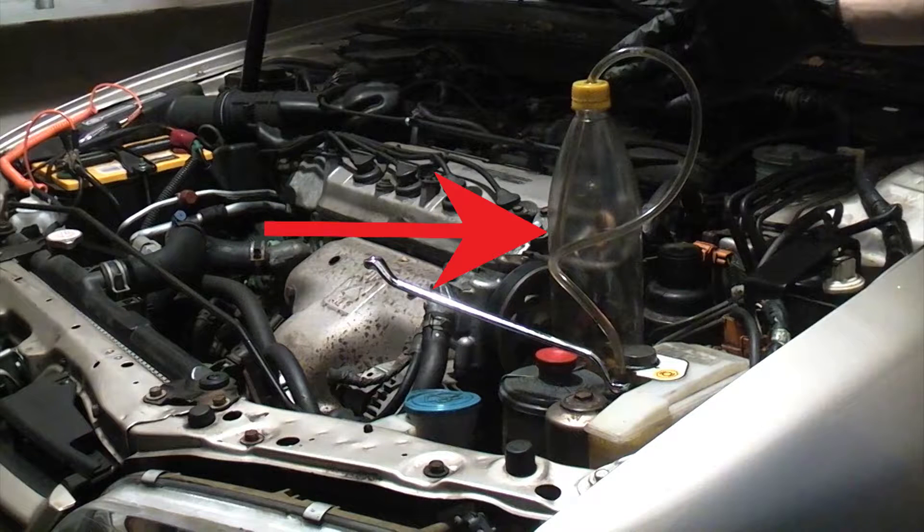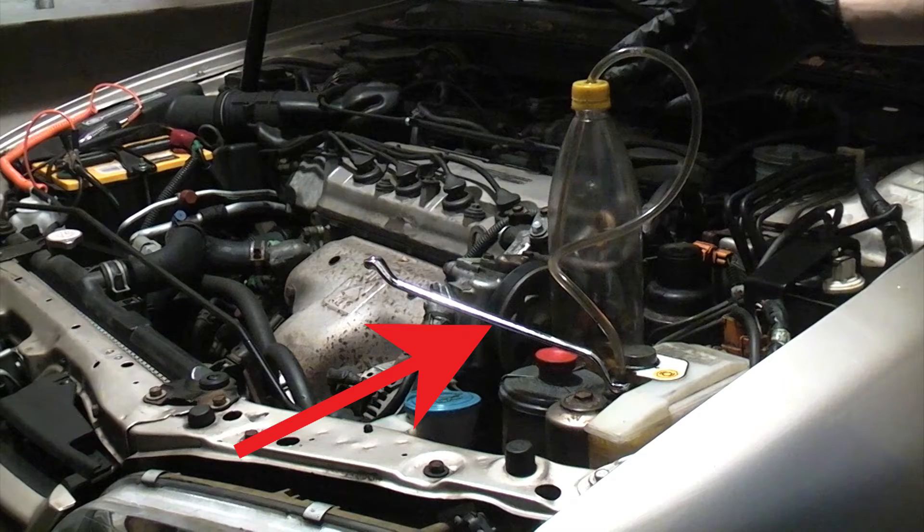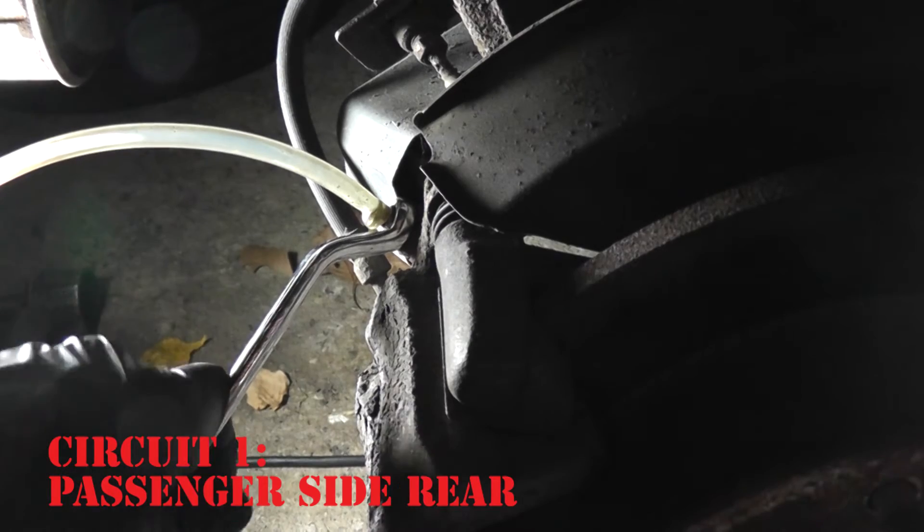Here's a look at my catch bottle — it's just a soda bottle with a hole drilled in the top with some clear vinyl tubing inserted into it. You want the hole to be slightly smaller than the tubing so it doesn't easily fall out. You want to leave the cap loose so pressure doesn't build up in the bottle. I'll also be using a bleeder wrench — it has a 6-point head instead of the more common 12-point head on a standard box end wrench, which is more likely to round off the bleeder. A bleeder wrench also has a longer handle for more leverage.